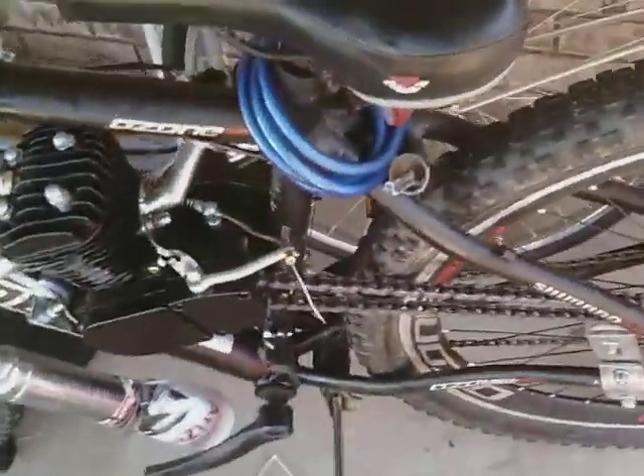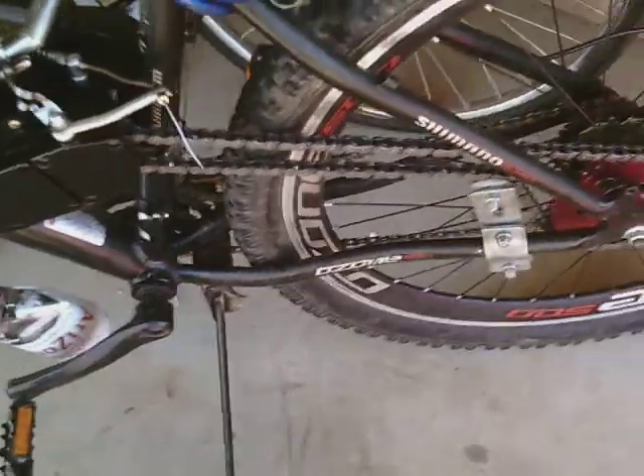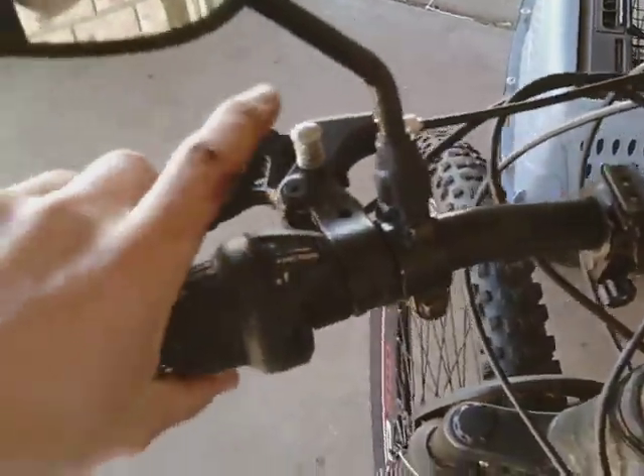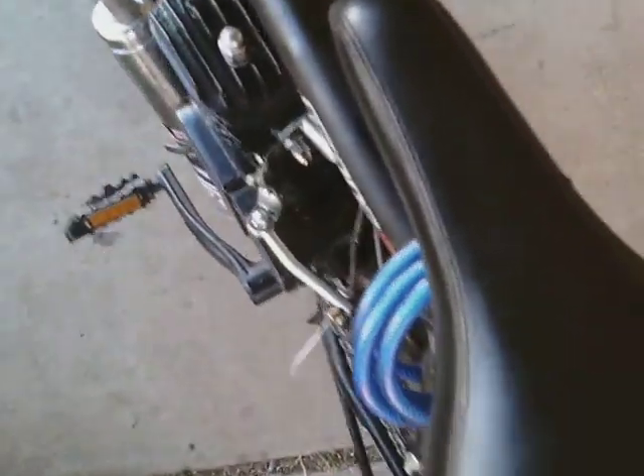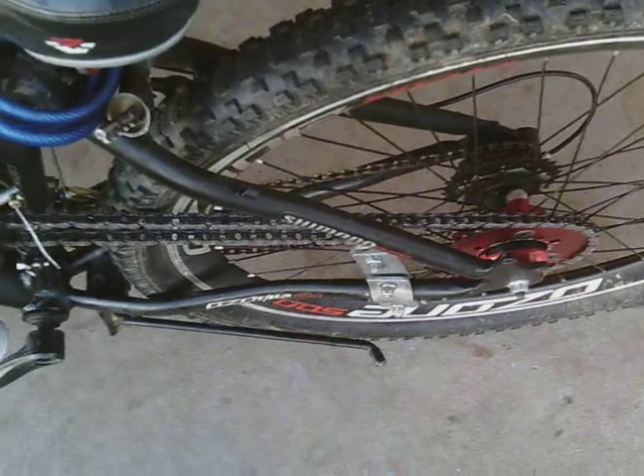Now, the chain — for tips when you put a new chain on, it will stretch, so you'll have to constantly adjust that. What I suggest doing is getting a spring tensioner. Now, what you're going to do — kickstand up here, I had to put another one on because my kickstand started to break. Now you can take your clutch handle, push your button in if that works. When you roll your bike, if you hear any pops or loud clacks, then obviously you did something wrong and that's bad. But if you don't, and you can roll it without anything clacking, then that's good.